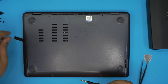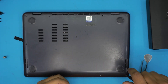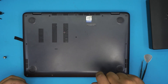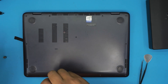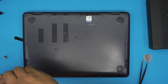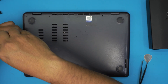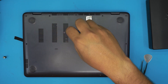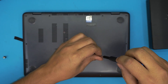With the new battery installed, the initial charge will be around 30 to 40 percent. Do not power on the laptop yet — leave it in the off position, connect the charger, and let it charge for four to six hours before turning it on. You don't want to power on the laptop with the initial factory charge of 45 percent or less. Let it sit and charge fully first.